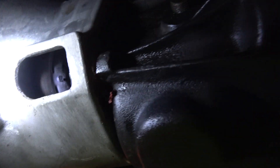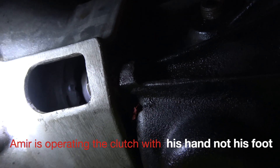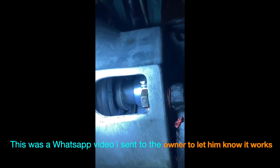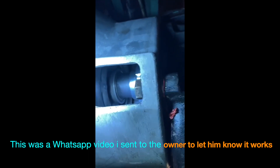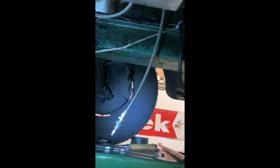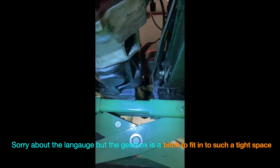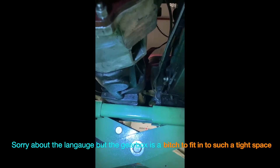Can you operate it? There you can see the clutch in, out, in, out - and you see it pushing the pressure plate really nicely. That looks really good - nice feel. That's with his hand, Bernard's hand, not with his foot. You can see how nice that is. We need to work out where we're going to put this bleed line. The box was an absolute bastard to get in - we had to virtually turn it upside down to get it in, then wrench over the engine. I was going to give up and take the engine out, but we got it. It works nicely.